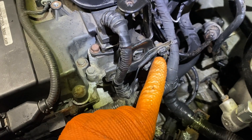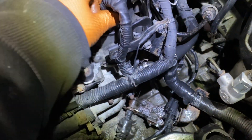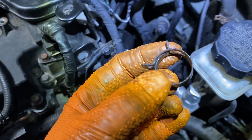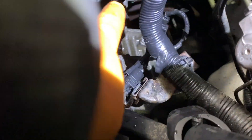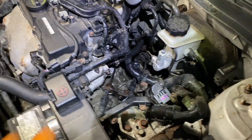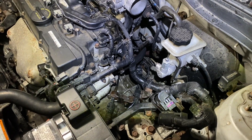Make sure if you did take off a ground for your fuel injection or the harnesses, you put that back — that's important — and any connectors you took off. What I do is when you take these off and put them back on, sometimes they leak. So I get screw clamps and put the screw clamps over the hose connections so when you put everything back, it doesn't leak. When it does leak, it's a pain in the neck — you've got to take everything off again. That's just a little tip.